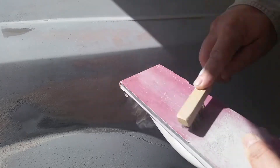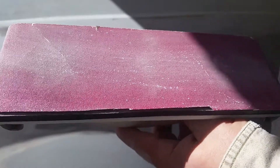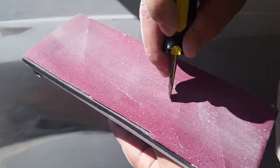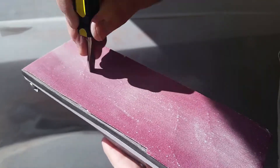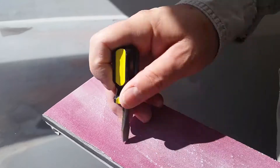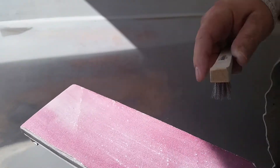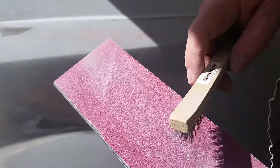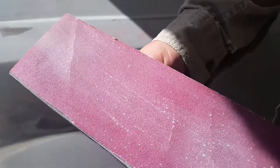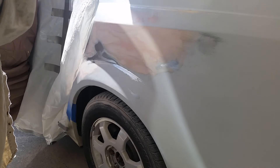To make my sandpaper last a little longer, I just use a little wire brush. The other thing I like to do is use a little screwdriver to knock off the places where the sandpaper gets loaded or galled up. Use a cheap screwdriver you don't care much about — just use the corners and come this way, whatever. It knocks it off and then you can use your wire brush. Some of them you just can't get off, that's just the way it is. I've got it sanded down pretty good and blended now — I'm going to shoot some primer on it and sand it off later and see how it looks.